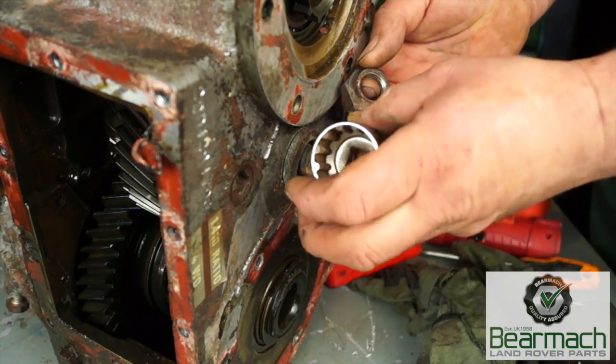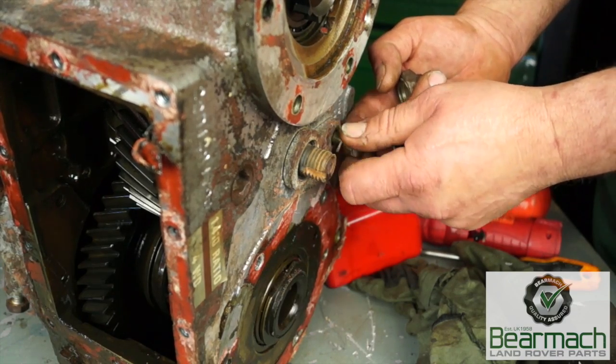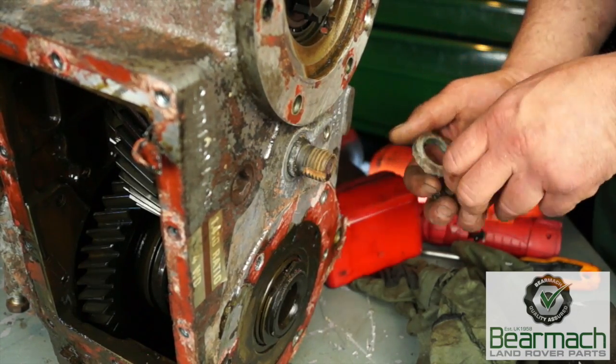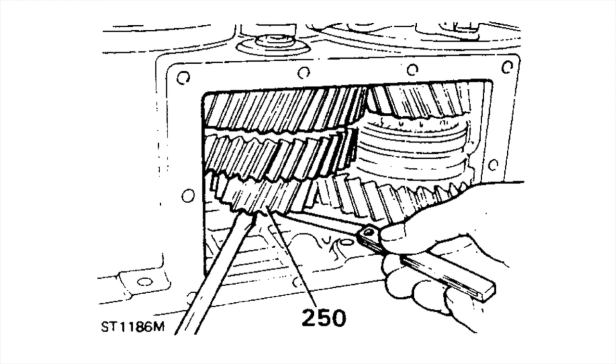If you haven't stripped off the intermediate gear pin, it's held on by a nut and then you have a lock peg with an M8 bolt. This is the gearing that has a collapsible spacer in between the two bearings. There is a difference — the older boxes will have a shim here which is set up in a different manner. This one is the LT230R which is on the earlier Defenders.